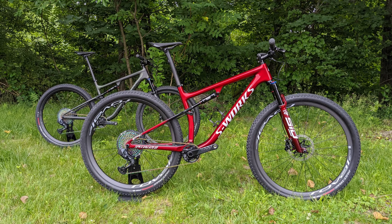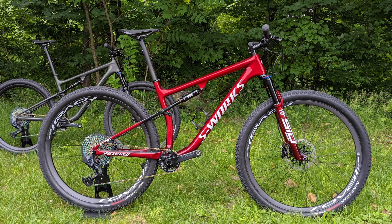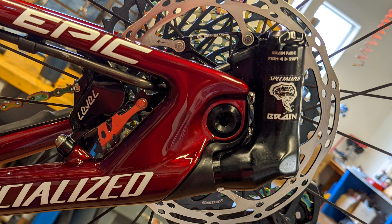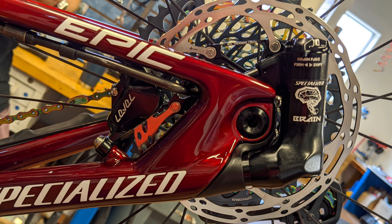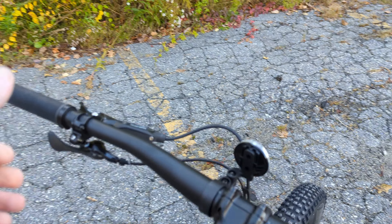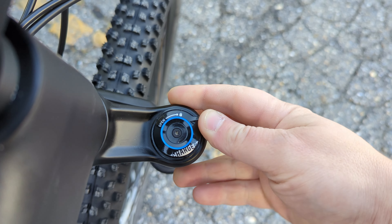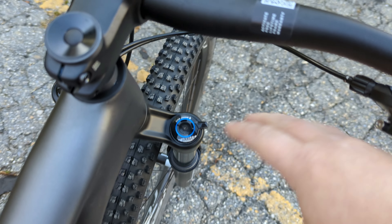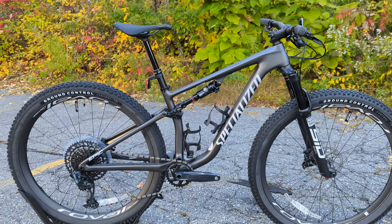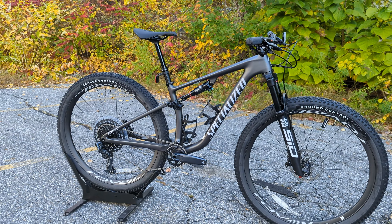On the non-Evo version, the standard variant — a race bike with 100mm of front travel and 100mm of rear — it runs something called a brain in both the front and rear that allows the bike to automatically control whether the shocks are open or closed. On a lot of bikes you'll see a lever on the handlebar or on the fork leg to stiffen things up manually, but the standard Epic has that happen automatically, giving it a huge advantage on XC race days because it acts like a hardtail until it needs to be a full suspension.